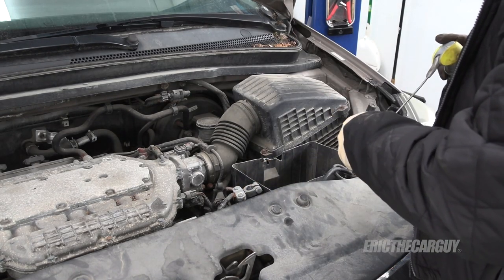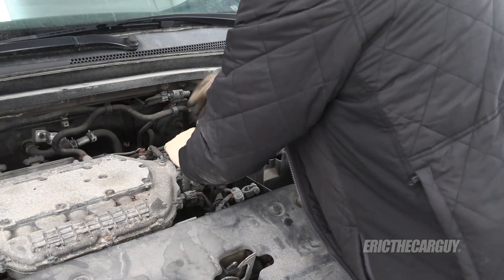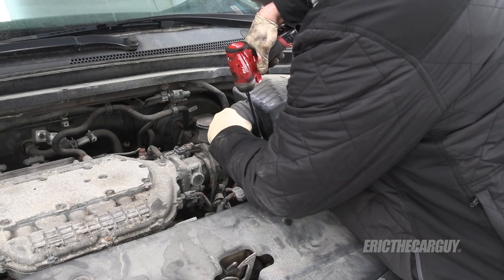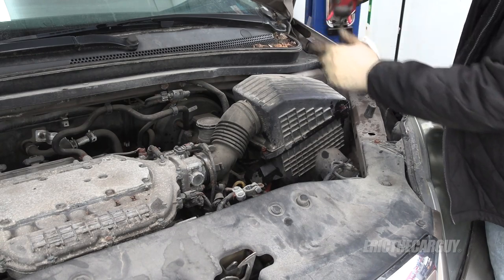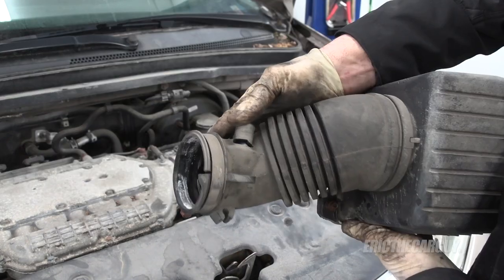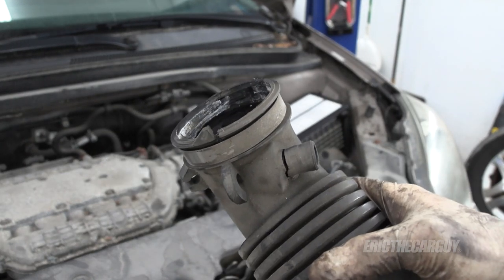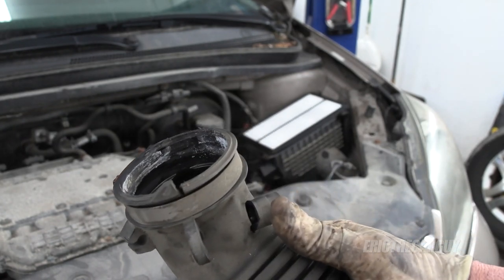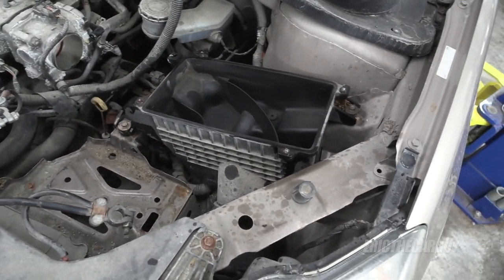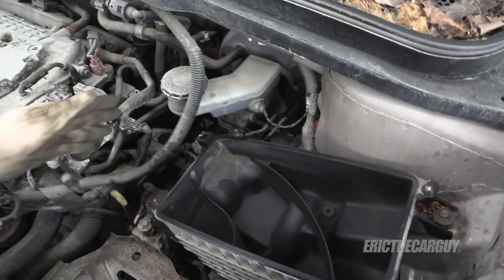Now this part should be really interesting — how often these actually come apart. Well, that's not cool — the boot is cracking. I'll show you in a second. Let's see where that boot cracked; I have to find another one of these. This isn't a mass airflow car, so it doesn't have a mass airflow sensor, but still I want to address things like this. I'm pleasantly surprised to find a brand new air filter in here. One fastener broke right here, but we have all kinds of room to get to the master cylinder now. Let's start by cleaning it.